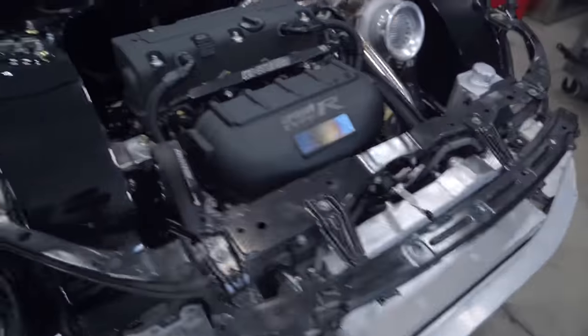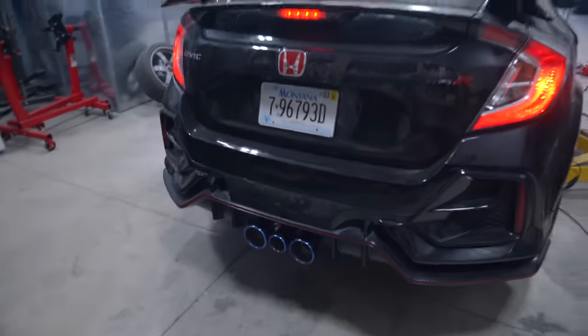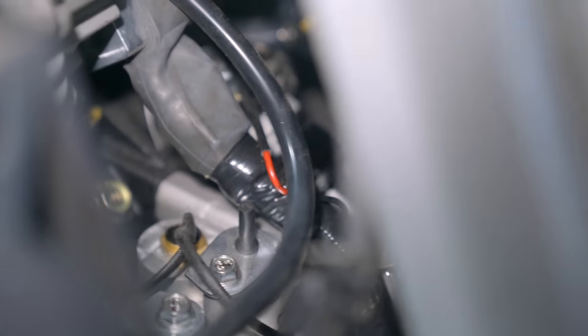Had a slight leak on the intake manifold — got that sorted and it sounds a whole lot better now. Of course it does sound way better with an actual exhaust on it; before it was kind of like a lawnmower. I did have a small leak on the top of the thermostat housing, and both of these fittings right there are leaking — they're both tight but still leaking — so we've got to figure something out there as well. But listen, she sounds healthy now.